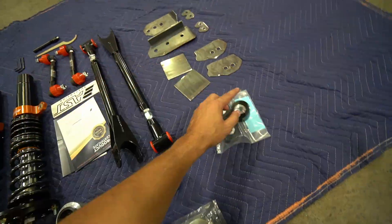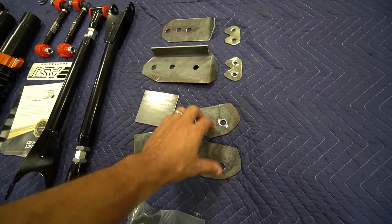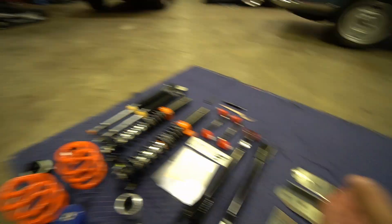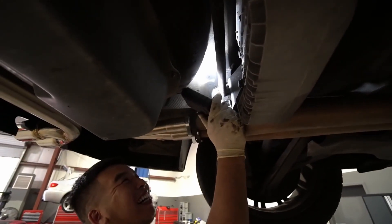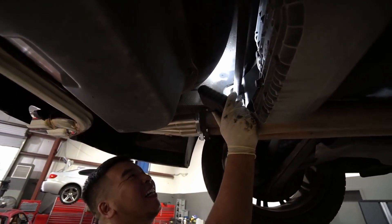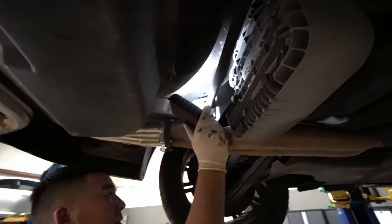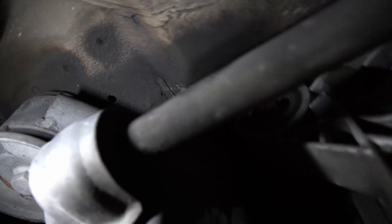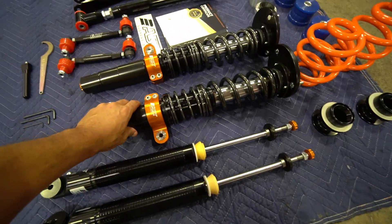We also have diff bushings, which typically account for loud gear shifts and thumps on low RPMs in first gear. And the main reason I'm here — these are plates built in-house at PSI Orlando to reinforce the subframe on my car. If you guys remember one of my previous M3 videos, we were able to see a very large crack underneath the subframe. We'll expose it today, hopefully without finding more damage, and get that reinforced.